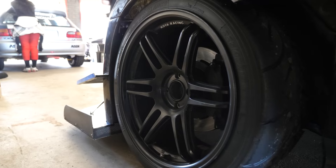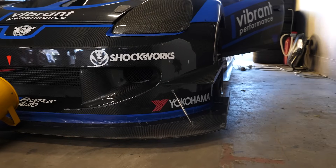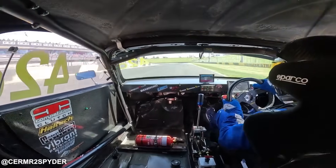Carrying that theme into suspension development — the MRS is McPherson strut all four corners. Most of it is off-the-shelf. The only custom part is the front lower control arms, so that we can adjust the caster to give the bigger wheels clearance from binding on the rear wheel arch under compression. The rear arms are all just off-the-shelf adjustable stuff. The coilovers are from Shockworks, who has spent a fair bit of time with us developing stuff and trying different spring rates and damper settings. We actually run the car at essentially factory ride height — it's just the body that's been dropped around it and the aero worked around the factory ride height. If it works from factory, assume they've got the right position.